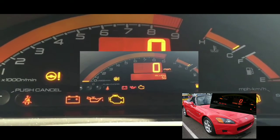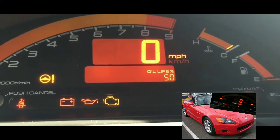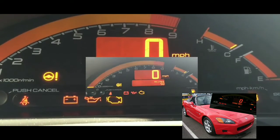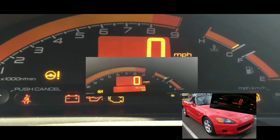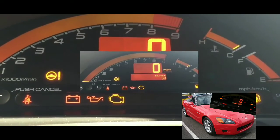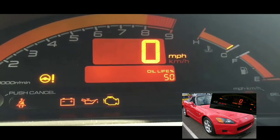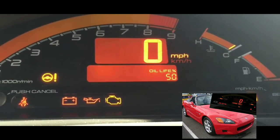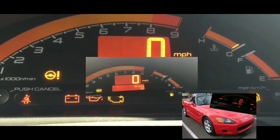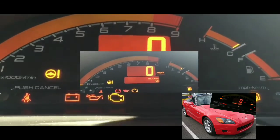Now, funny thing is, I had an issue like this a couple of months back, and I was eventually able to start it, and it hasn't occurred since. I believe what I did was take one of the posts off the battery, put it back on, and did a couple of things that I don't remember because it was like 6 months ago. It's been doing this sporadically, and when it did happen, I knocked the starter with a long crowbar, and it did start every single time.